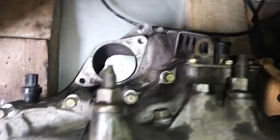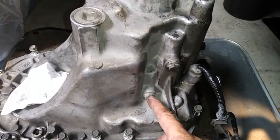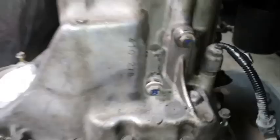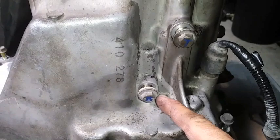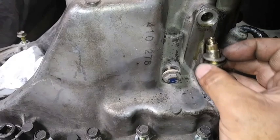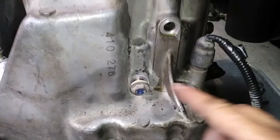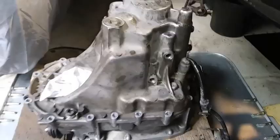So I loosened all the size 12s. Now I'm going to take out these two. They have a bolt and inside there is like little springs with BBs on both of them. I'm going to take them out, then take out this one, take the clip inside, and then pop the case out. I loosened these two bolts size 12 also — there's going to be a little spring with a BB inside. I'm going to use a magnet. Got the BB. I'll do the same on this one. I took off these two size 12 bolts with the little BB.